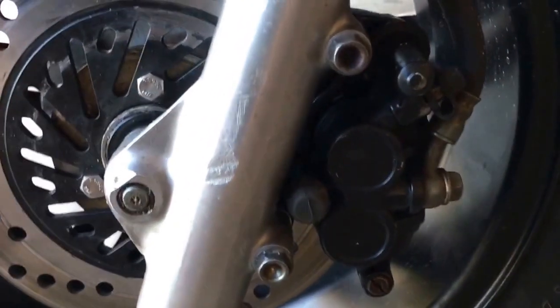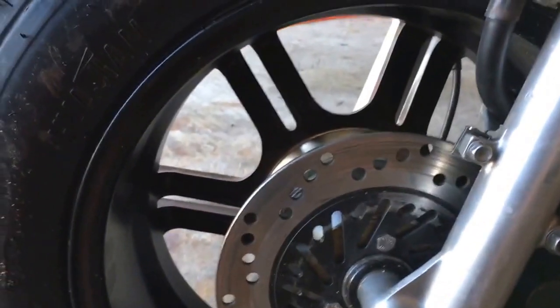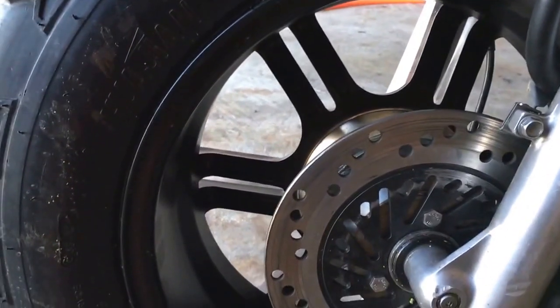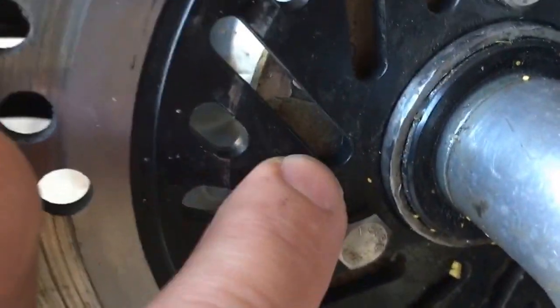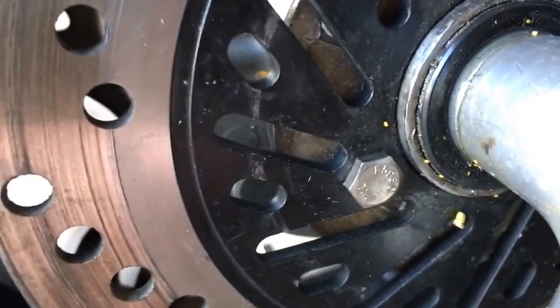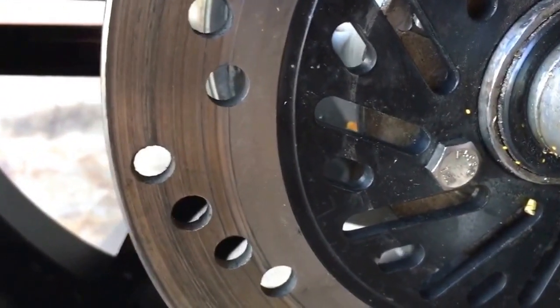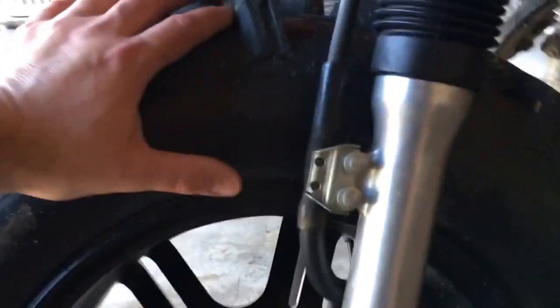I've maintained this easy-to-take-off dual piston caliper — very easy, two bolts, boom boom, take it off, put some pads on, it's like 10 bucks. Much better than having to disassemble the entire front end of your bike, which I was doing once to twice a year because of brake problems. Once you get it mounted, you can see the hub through the slots cut in the disc. You just put a one and a quarter inch stainless bolt with a nylon nut so it won't back off — piece of cake. It stops on a dime compared to the drum brakes. I also installed new head bearings — or neck bearings, depending on who you're talking to.